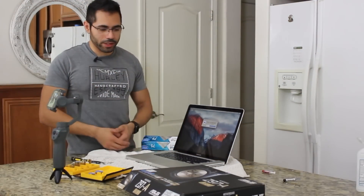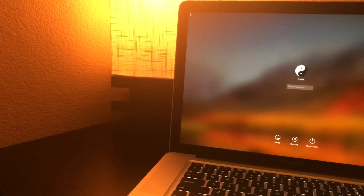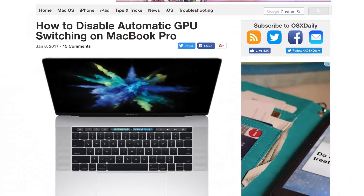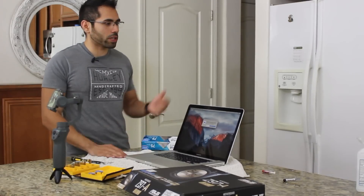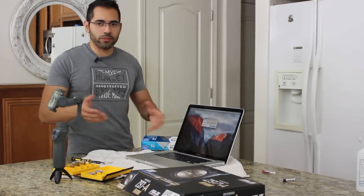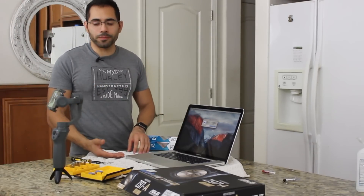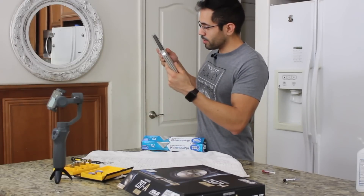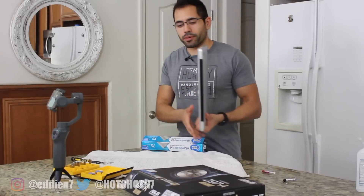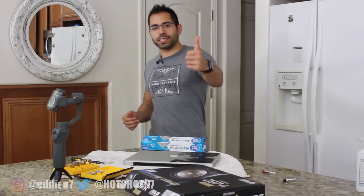In my case, I'm just going to sell this MacBook — it's in perfect shape, probably around $400–$500. If you wanted to keep it, you can disable the dedicated GPU so the Intel processor handles the display, preventing the issue from recurring. To disable the GPU you have to do it within the user profile, not from the boot menu. Hope you guys enjoyed this repair guide for the MacBook Pro model A1286 — smash that like button and subscribe, and I'll see you in the next video.